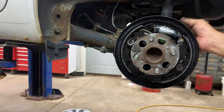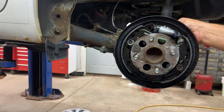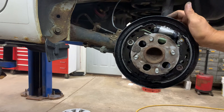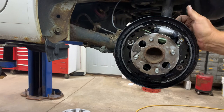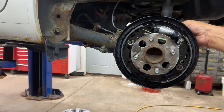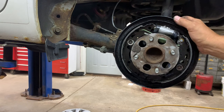And when I'm spinning it with the electric drill, it kind of removes the rust around it. But then you get the line in the back of the wheel cylinder, put some anti-seize on it, tighten it up, make sure it's tight, and then you can put your bleeder back in with some anti-seize on it, tighten it up, loosen it back up, let it gravity bleed, and when you don't see no more air bubbles, you can tighten that, snug up the bleeder screw.